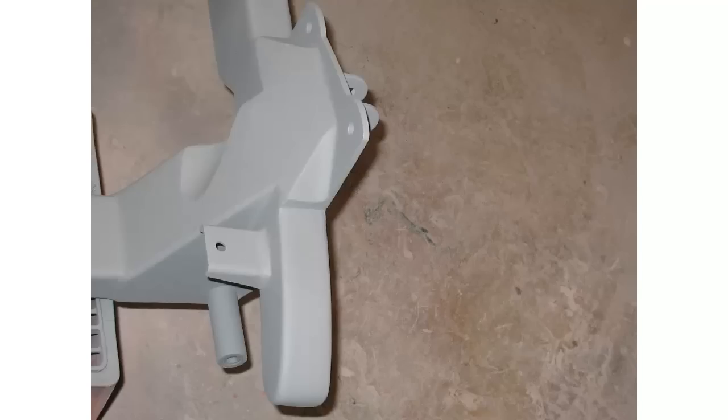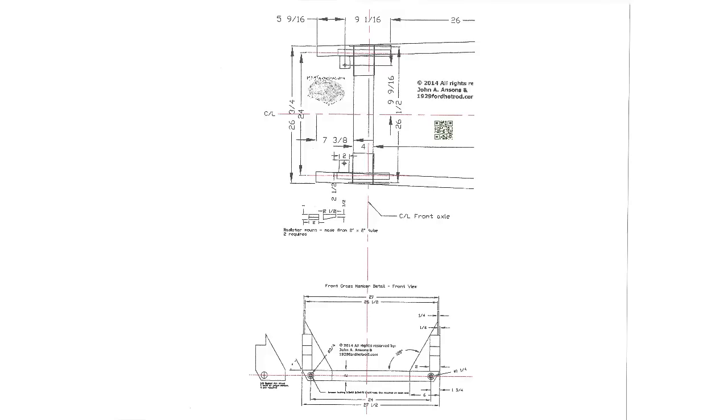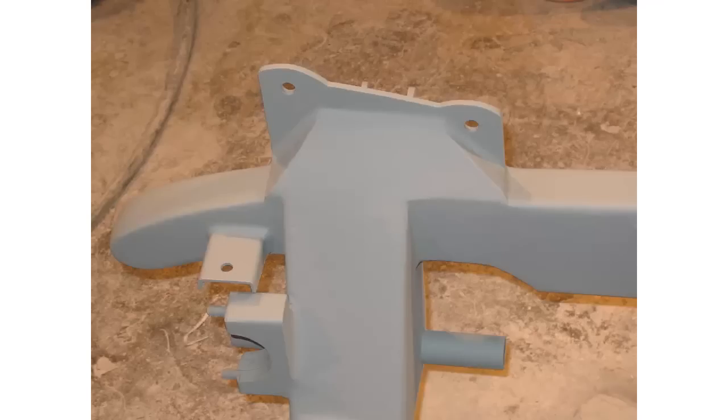In order for me to use the Corvette steering rack, I needed to weld in a small section of 2.5-inch tubing on the driver's side of the crossmember. To add a bit of strength to the front crossmember, I welded in 1/8-inch plate gussets to both sides, front and back, just for a little bit of extra insurance. I added in some additional support for the upper control arm mounts using 1/4-inch plate.